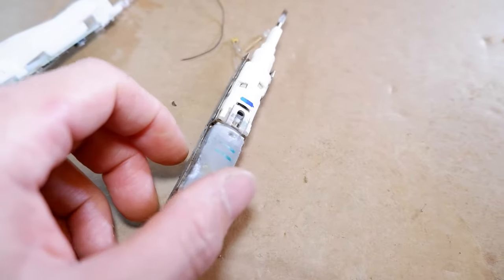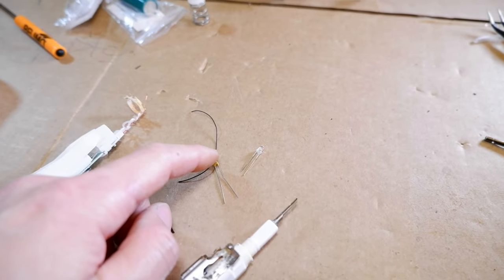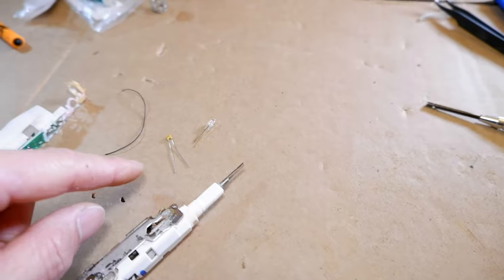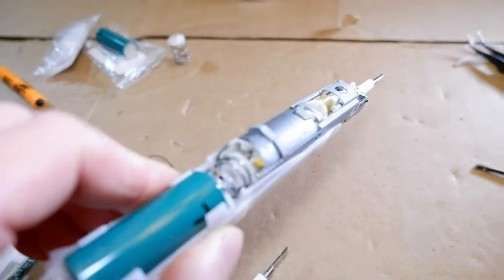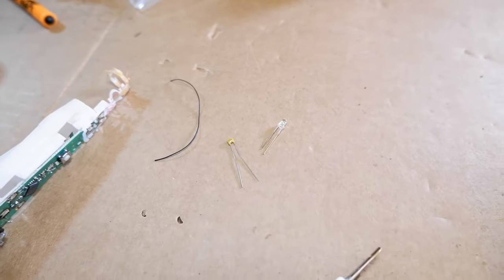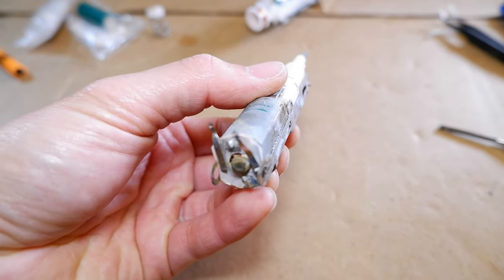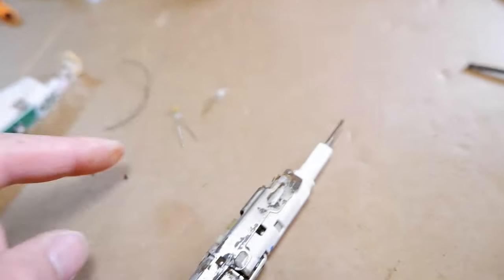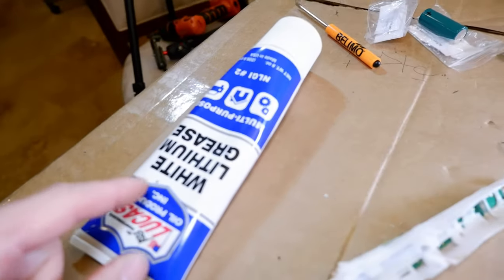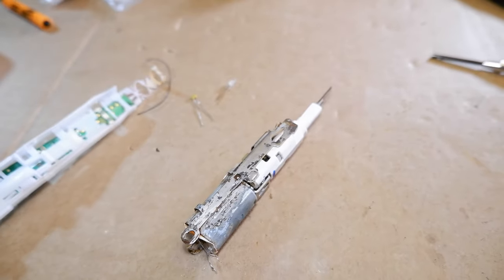Got this thing pretty cleaned up with steel wool and white vinegar — most of the corrosion and rust is off. I've got a new LED to replace the corroded one and a thin piece of replacement wire. I also noticed the other toothbrush's motor has a little capacitor that this corroded one is missing, so I found one from my electronics kit that's the same physical size. It may not be the exact same rating but it should work — all it does is buffer the initial motor startup. I'm going to solder it in to match the other toothbrush.